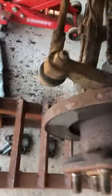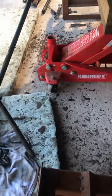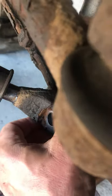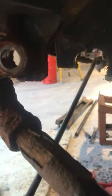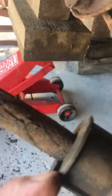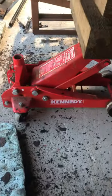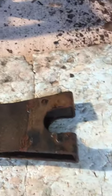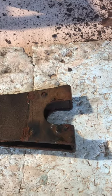Part two. Took those clamps off. You take this big bolt out here — it's a 24mm — these ones here are 22mm, 13mm for the clamps. This needs to slide to the side so that that big arm, the cross member, which is that there, can drop out. I've started to work from the passenger side, just because that's where I work from.